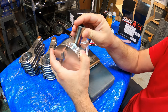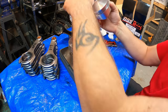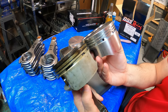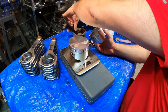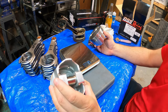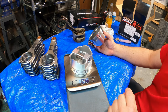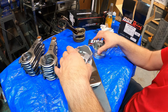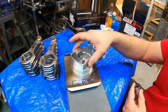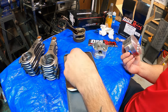The reason why I picked this particular model of piston is that they represent the modern style piston that the LT1s have, which is a short skirt design. But also most important is the weight. With pin and piston, we're looking at 629 grams, which is phenomenal. Just for your tech guys — without the pin, 493 grams for the piston, and about 136 grams for the pin.